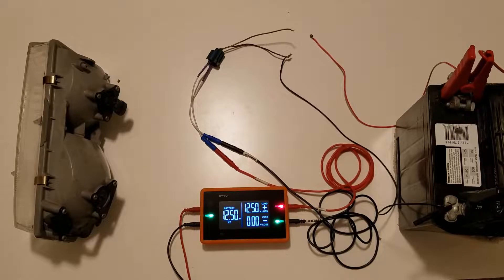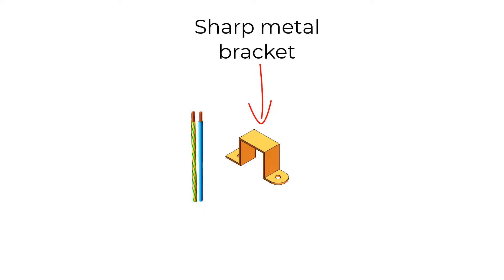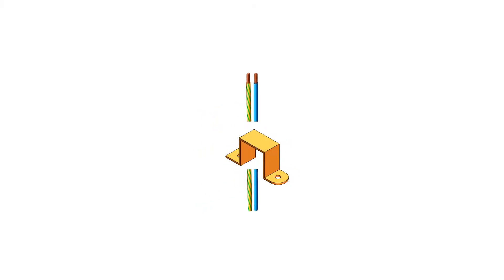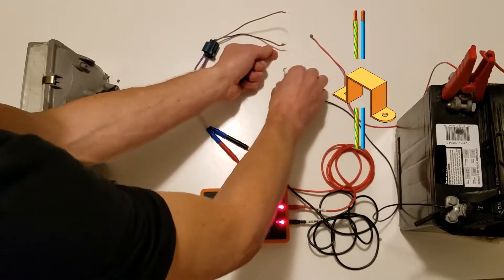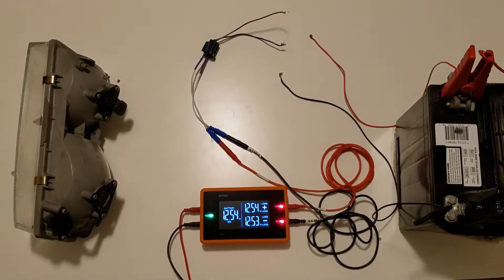Here's what's really great with Devo — you can test the positive and negative circuits at the same time. There are scenarios where your wires, because they're in a harness and routed together, both circuits might be affected. So you wouldn't just have an open in one circuit but in both. With a typical multimeter you can only test one circuit at a time, but with Devo you can test both sides simultaneously. We can see that we have an open on both circuits at the exact same time. Even though I used a headlight in this example, you can apply the same technique for any component and any circuit on a car. And just like that, you can quickly identify an open circuit using Devo.